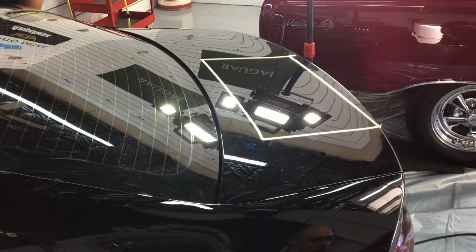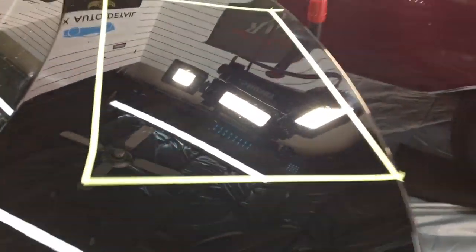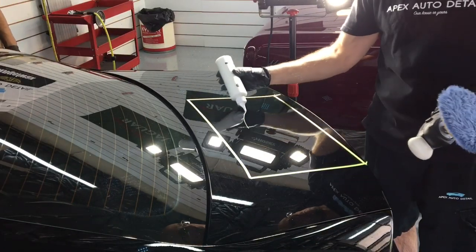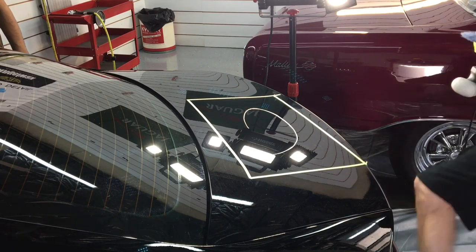I'm going to grab the camera and bring you in. With just two passes — that's what a crisscross pattern is, up and down then left to right — it gets rid of two layers of the imperfection, yet leaves behind some of the deeper scratches you'll see down towards the lid of the trunk. So we have made a huge difference. I believe I could do better with this combination, but we are still going to experiment with a different pad on the other side of the panel. But first, I want to show you what yet another pass will do.